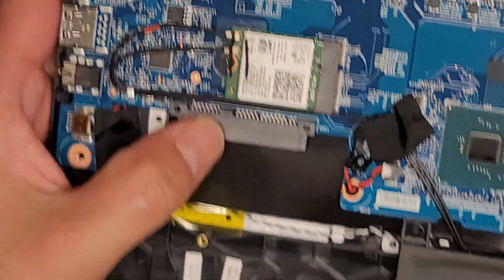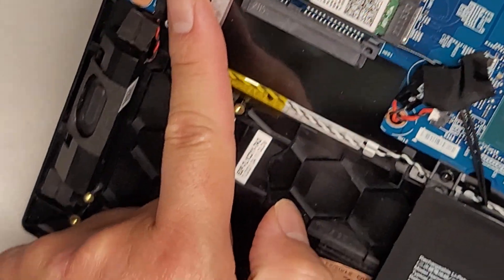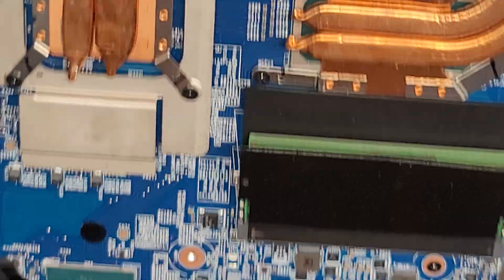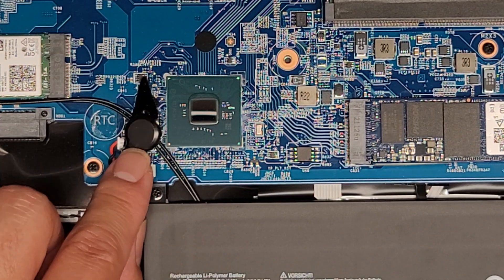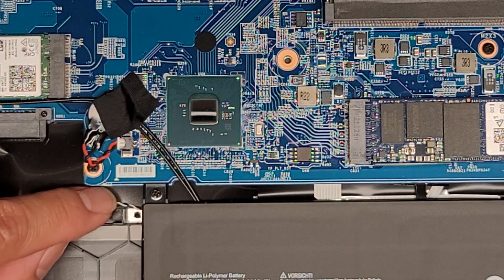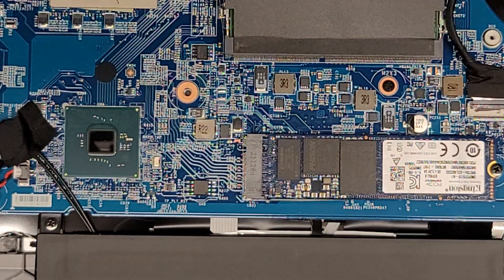There's a wireless card here and a two and a half inch SATA hard drive connector — you can also put a two and a half inch SATA SSD. There's a speaker connector here — one wire going there and the other wire running all the way across to the other speaker. There's also a CMOS BIOS RTC real-time clock battery here — it's a small one and it just plugs in right there. If you're replacing it, take note: the red wire is going up towards the GPU and the black wire is going down towards the main battery.